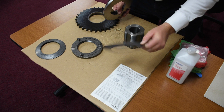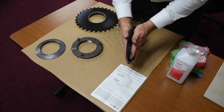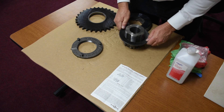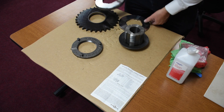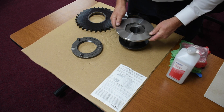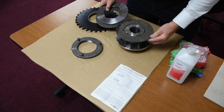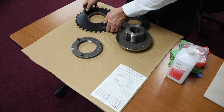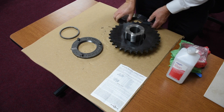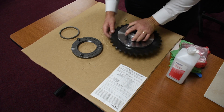Here is just one spring. This spring is made out of hardened steel, and it will compress but it will always spring back. In this particular case, we're going to use two springs. Here we have a retention plate that has the keys on it. We have a friction disc. Just to show you how this works without going into full assembly, the sprocket goes in here, and the friction discs go in here. This whole unit can turn without the sprocket turning.